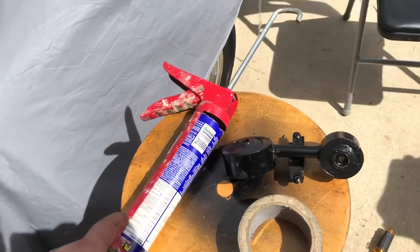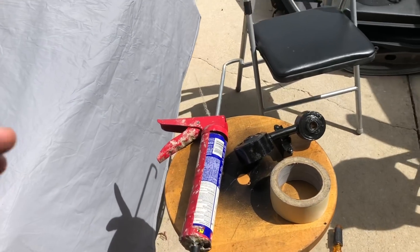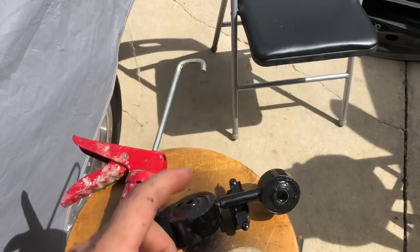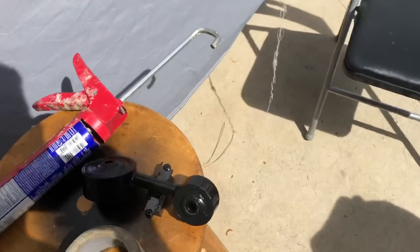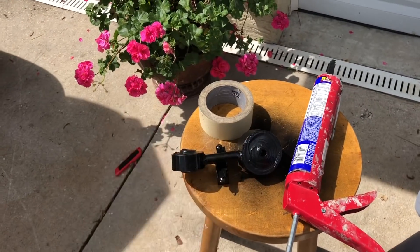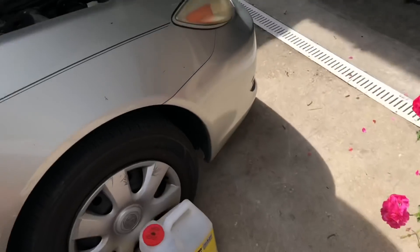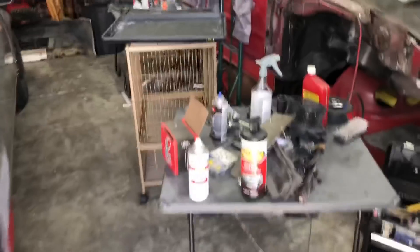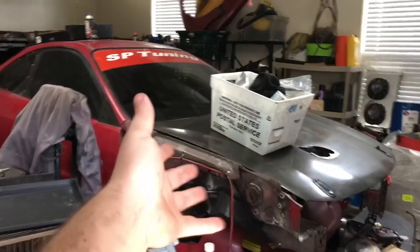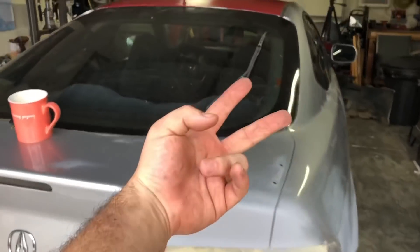The set time should be about a couple of hours, so it gets hard on the outside, and full cure happens after about three to four days — that's when we'll actually be putting it back on the car. If you have the time to wait or you have an extra set of mounts, this is a perfect thing for you. It only costs about six bucks and you can do this at home with very basic tools. Thanks for watching — if you have any questions about racing or daily driver topics, leave them in the comments below. Check out SB Tuning's older content including our all-wheel drive CRX. See you on the next one!